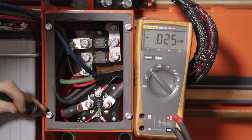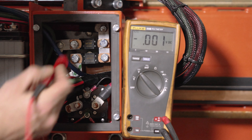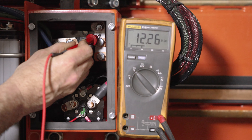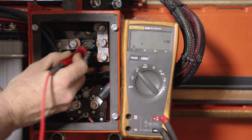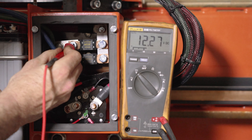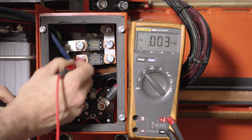We'll use a ground anywhere and take 12 volt positive. We're going to go over here to the right side at the top first — that's where our battery power is coming in. 12.2 volts. Come across the fuse and take another reading here: 12.2 volts. That 450 amp fuse is good.